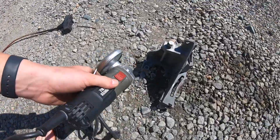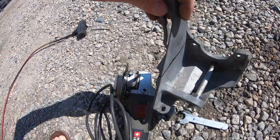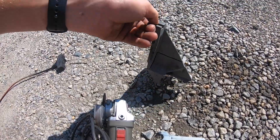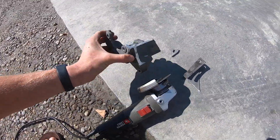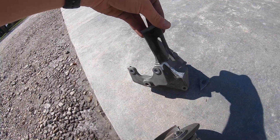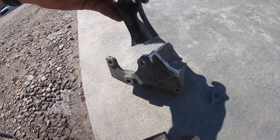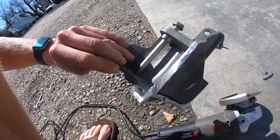I got out the zip wheel and I'm going to go ahead and cut off the remaining part that we don't need for the power steering bracket, getting this stuff ready for paint so we can do one big paint session. I made pretty quick time with the zip wheel. You can see this piece right here was the piece I cut off — it was actually pretty easy and simple. We also cut off this little bracket, which is still really hot. This thing looks kind of ugly so I'm going to clean it up with the grinder before we paint it.